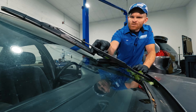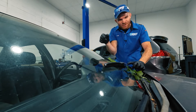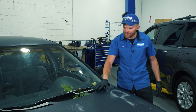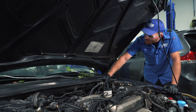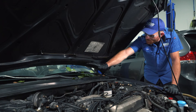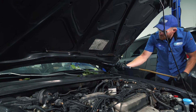Let's start by moving these wiper arms into the proper placement. If they were still attached on that wiper transmission, they really shouldn't move like this. Let's pop the hood and start removing the cowl. With the hood up, I have a clear view of the wiper cowl, but before we remove it, it's a good idea to remove as much debris as possible. We are also going to have to remove each of the wiper arms — we'll use some compressed air for this.